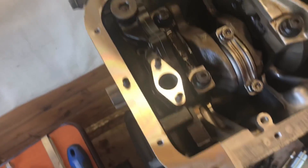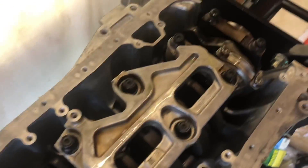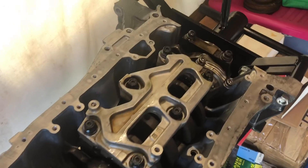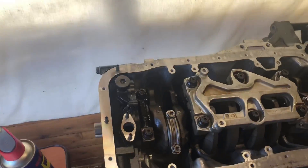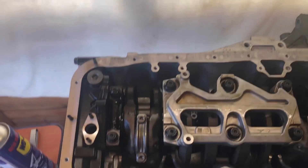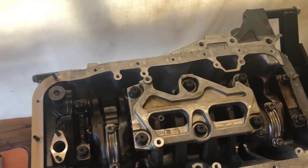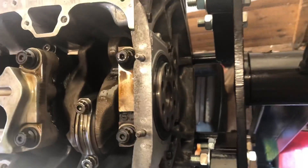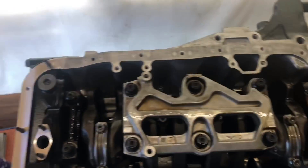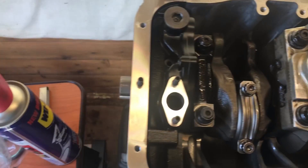Oil pump's all installed. I put a little bit of sealant around it - only a tiny bit - just so I don't get any leaks. Now I've got to do the crank seal on this side. I need to get some breakfast in between as I'm absolutely starving. I've just installed the cam seal on this side and obviously the oil pump's down. Now gonna get the under-tray on - I'll be putting the gasket on with a bit of sealant as well.